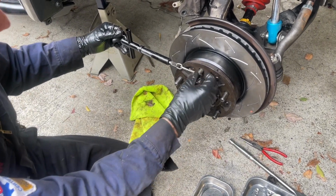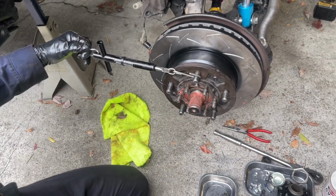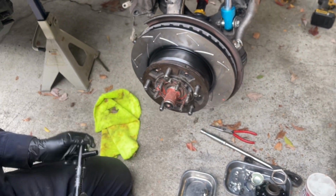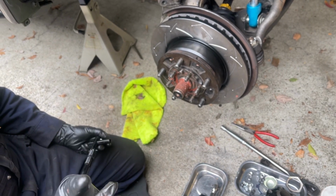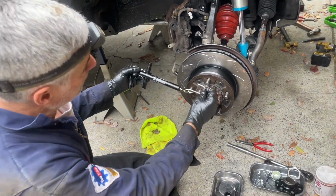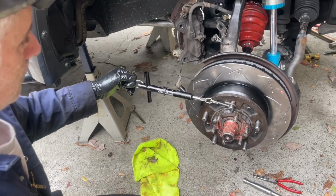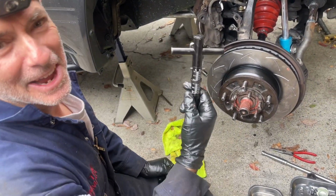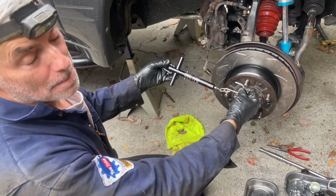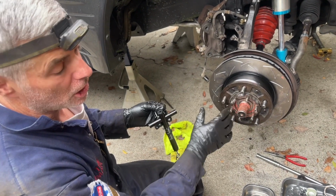And now we have it right about 12. That's at least what it came out the last time we pulled on this. It came out to be about 11. I think we're going to go just a little bit tighter because the spec is 9.5 to 15. So we're going to go somewhere in the middle, right about 12. All right, I think I finally got it to where we want it at about 12 pounds of force. And it was 11 this time. It's in the ballpark, so I'm just going to call it good because sometimes I pull it, it's 12, sometimes I pull it's 11. I think we're happy with that. We're in the spec, and we're going to call that good.